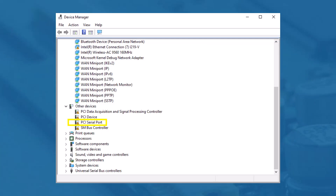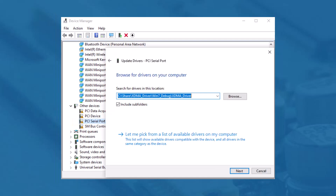Step 2: Install the device driver. If a Passmark PCIE test card has been installed on the system previously, the device drivers will be automatically installed and the installation is complete. If not, start Device Manager by selecting Windows and typing Device Manager, or through the Control Panel. If the card has never been installed before, it should appear as PCI Serial Port under Other Devices. If drivers are already installed and you wish to update, it should appear as Xilinx DMA under Xilinx Drivers. Right-click the device, select Update Driver Software, then Browse My Computer for Driver Software, enter the driver location, and click Install. A window will confirm that Windows has successfully updated your driver software.